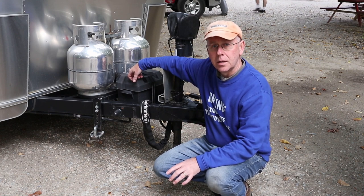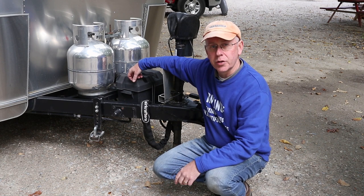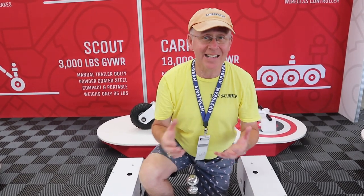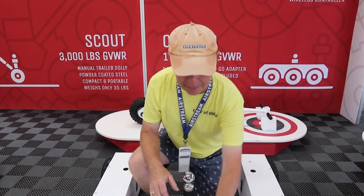To show you why it's difficult to use this chart, I'm going to talk with Caleb here at Park 360. He's going to demonstrate using one of his vehicles. When somebody says how do I know if my battery is good, they always point to this chart and say just look at this — if you're at 12.2 you're at 60% or whatever. But that only applies to a battery that's off-load and at rest. As soon as you put a load on that battery, voltage is going to drop down. This carrier here really demonstrates that.